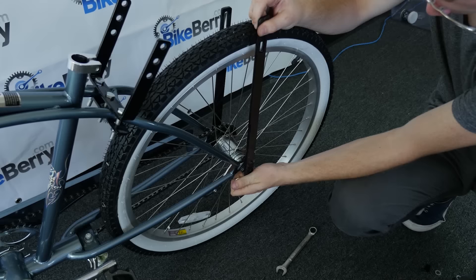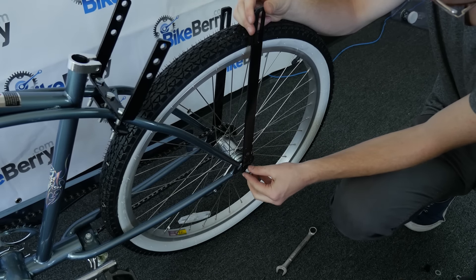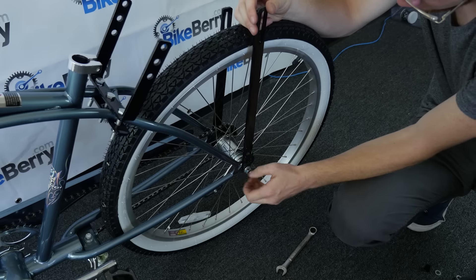Next, we'll put on the two side mounting bars. On this bike, we'll put it on the lowest setting, but it may differ for you depending on the dimensions of your bike. Be sure the top slit of the bar goes in an upward diagonal angle that goes from bottom left to top right. Putting this the wrong way will prevent you from lifting your engine up.